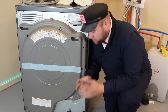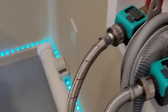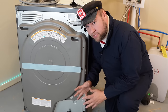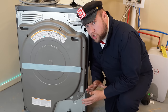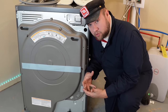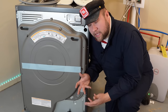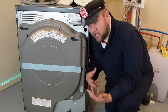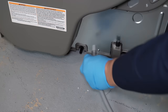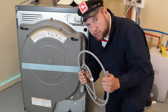We start the journey on this video not at the front of the dryer, but the back. The thing that makes this unique is that it is ventless, meaning there is no giant ducted metal vent that protrudes from the back of this, so you can put this dryer in a whole lot of different places than you would normally. This is a heat pump dryer, meaning there is a compressor that more or less dehumidifies the clothes to get them dry. And unlike a lot of other ventless dryers, there's no large catch tray — this unit drains all the water from your clothes into your drain line, just like your washing machine would.